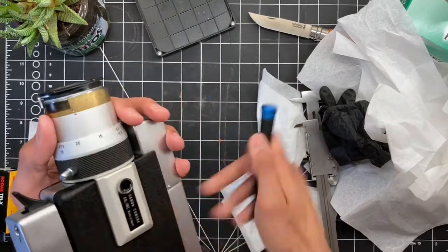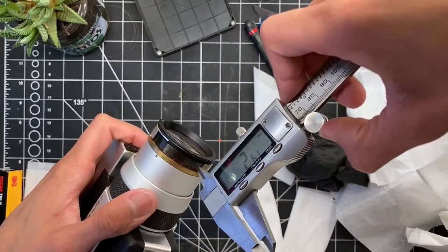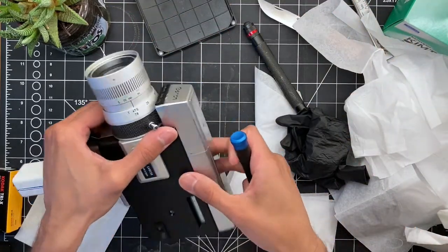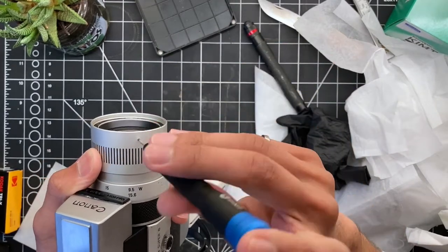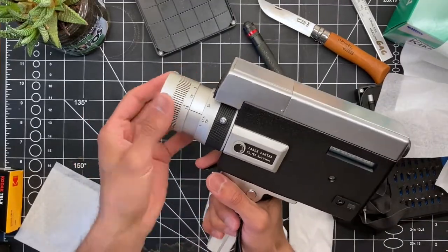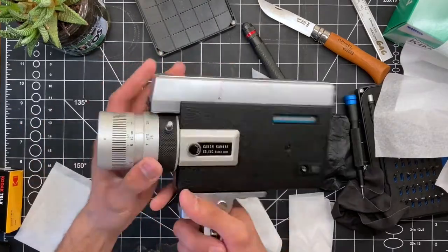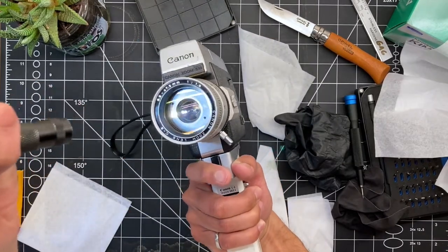That may seem complicated but if you take a second to think about what you're doing with this lens, it's not too difficult. The gap between the lens and the hard stop was about two millimeters, so you can use that as a rule of thumb to see if it's in the correct position. Using the silver sheath to locate the focusing ring, with the inner lens set to infinity I had the markings on the cap set to infinity as well. The focusing ring is now a little bit harder to turn, which is exactly what I was hoping the chain lubricant would do. Inside the lens there is really not much debris at all, so I'm excited to put some film in this camera and see how it comes out. Hopefully that was entertaining and informative — thank you for watching.